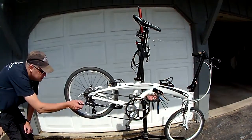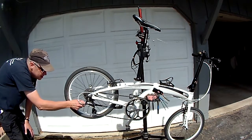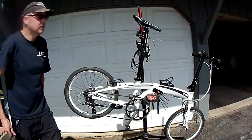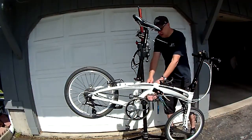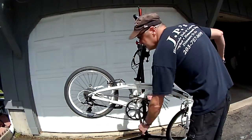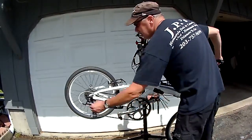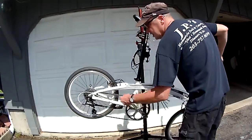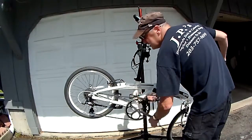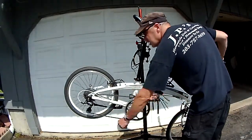Just lining up the pulley on a Shimano system. I prefer it to be a little under adjusted so it hops down to the smaller gears faster. That way when I want to hammer it downhill, it snaps into those gears quicker. A little tighter. That should do it. Nope. Don't want it to hop 2 gears. Alright.